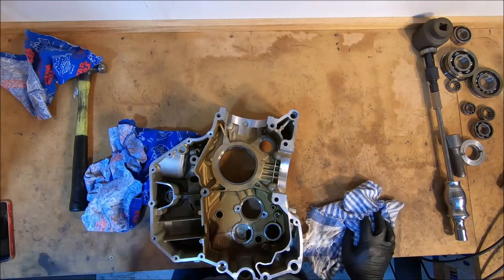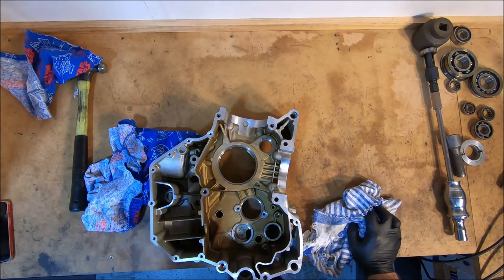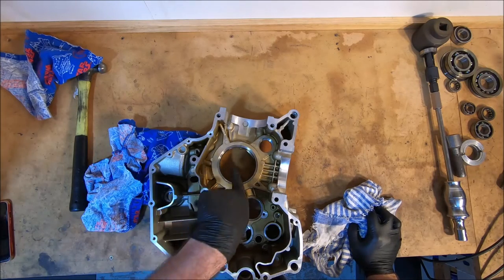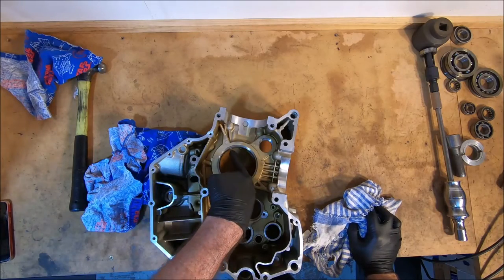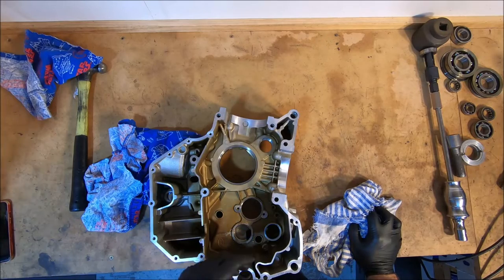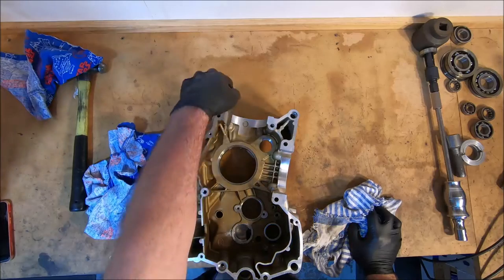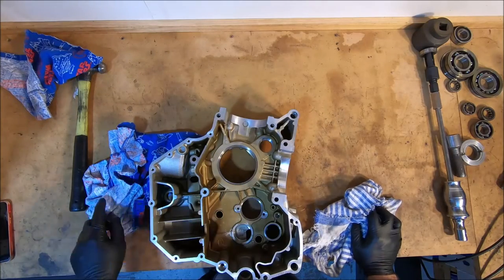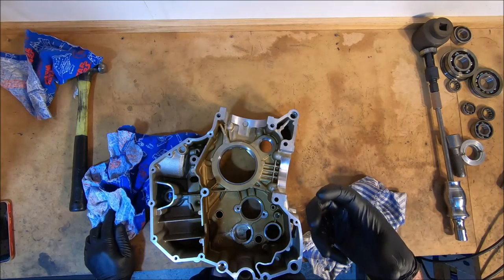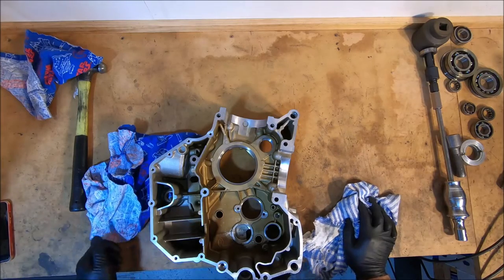It's all those blown through. When I wash them, I usually wash them in the parts washer, and then I get the water pressure washer, and pressure wash them and run water through all these holes. Blowing air through holes like this will get out anything loose, but if there's anything in there you really need to move, water is by far the best way, or oil. You can even pump oil into them if there was a blockage, with an oil can poked in the hole, going squirt, squirt, squirt. Because it's very viscous compared to air, it will push things out that air just won't.